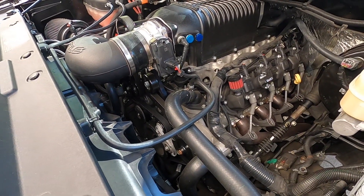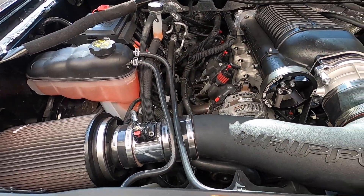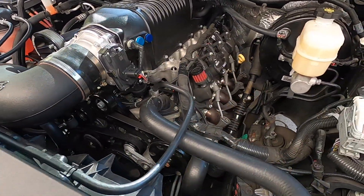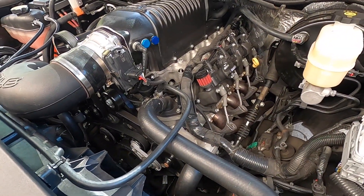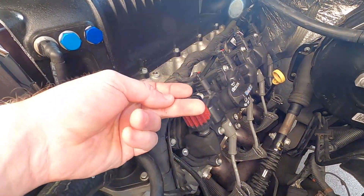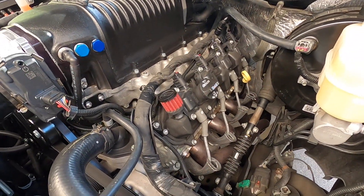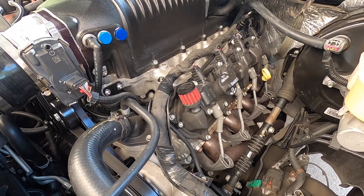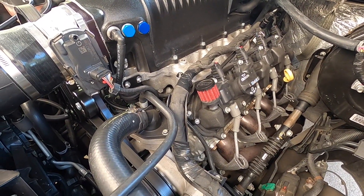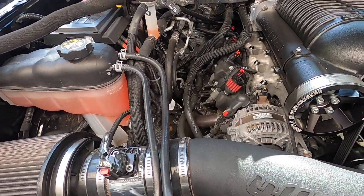You might want to check into that and clean it up by capping it off. I know I may have to change my oil more often, and I don't need 15,000 comments telling me I need a catch can. You can see I've been in boost — there's no oil — there's a good baffle system inside these valve covers. I wouldn't worry too much about it.